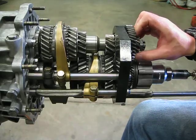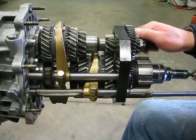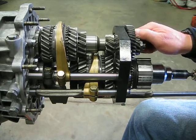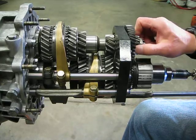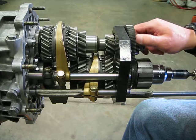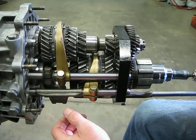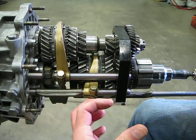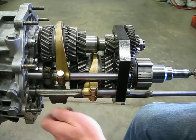What you want to try to do with the RPM input — with the input shaft and the clutch out — is speed up the engine, or press the gas a little bit, enough to try to get it to mate the speed of this shift coupler on the output shaft. It's really a by-feel kind of movement to mate those two RPMs. What that does is allow the shift coupler to move over the synchronizer assembly at the same speed, without having to use complete friction and locking force in order for it to go into first gear.